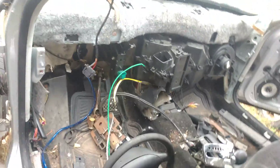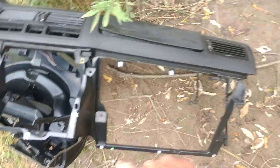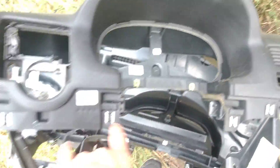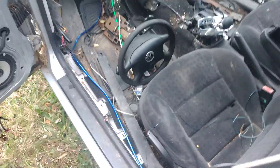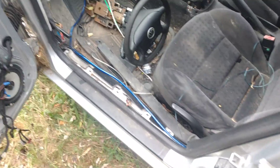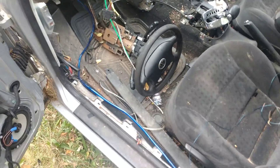It's actually pretty easy to get the dash out — they come out decently easy. There's just a bunch of screws. You get the center piece out first, then pull the bezels off, the glove box out, the gauge cluster out, and then there's just a bunch of T20s that you pull out. The whole thing unclips and pulls. You can bend the center piece without breaking it, and that will allow you to get it past the steering wheel if you don't pull the steering wheel out. There's a way to get the steering wheel off using T20 holes in the back. I just bend that little piece and pull it out — the dash is perfectly good, you could resell it.